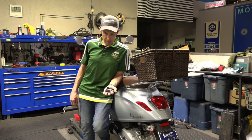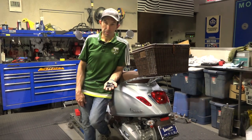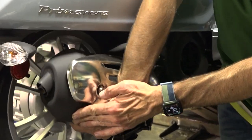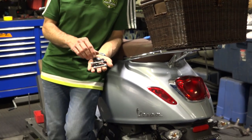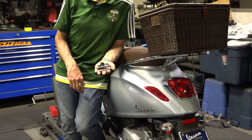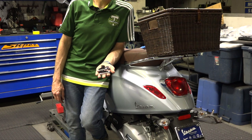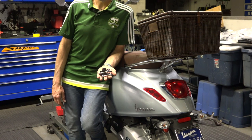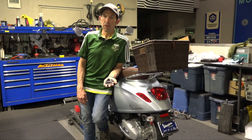One of the more important things to do is install the spacers in the suspension — a lot of people skip this step, and the problem is your muffler will make contact with the frame. You're going to limit suspension travel by about a half inch by installing these spacers on the shock absorber shaft. The kit includes new stainless steel hardware; you do reuse the lower shock bolt. This kit is specifically designed for the 150cc Vespas sold from 2015 and newer.